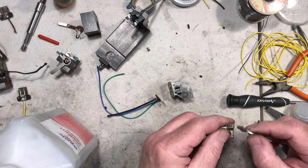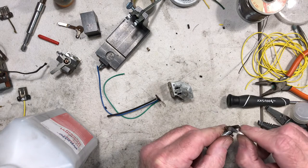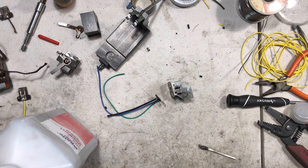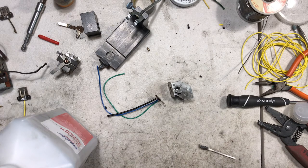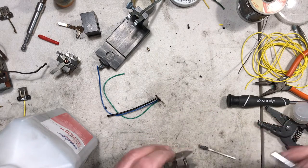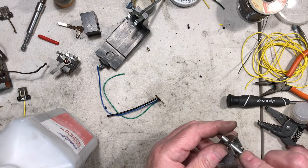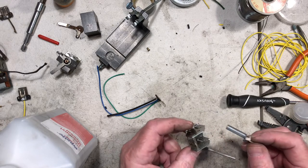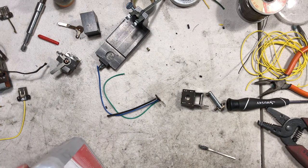Simple maintenance on these is basically just keeping the little ends where the drum unit spins — I just put a little drop of oil on those on occasion. The plunger will stick sometimes, that's why it hesitates to shift like it's supposed to. Reason being, once it goes up and through into the winding, it just gets old, gets stuck every once in a while. I just shoot just a tiny bit of WD-40 up in there and that usually frees it up and starts to work pretty well.